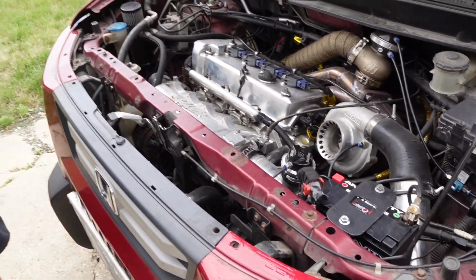So we started this project out with our Rowdy Racing spec K24 that we do for all 800 or more horsepower builds. This one has Wiseco pistons. They're about 10 to 10.5 compression. We're also using the Wiseco Boostline rods, ARP head bolts, and the actual cylinder head has got the full Ferrea package. That's what we do on 9 out of 10 of our builds. We've done it on our drag car and it's just been proven time and time again, so this one was no different.